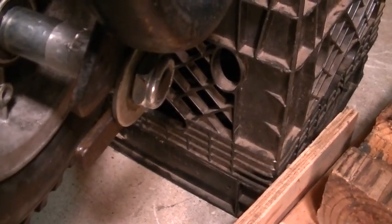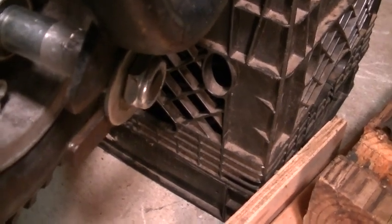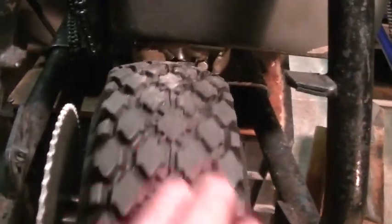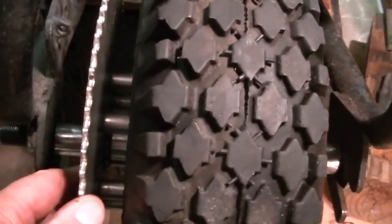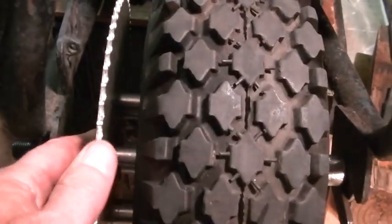I think maybe by taking the axle out and vice-gripping the inside, I can put one nut on equidistant - about halfway - so they come out even. I just snugged it up because I wanted to see what was going on. The wheel looks right, the chain looks right. But there's a wobble - it's not a big wobble, but I don't want it. I thought I did everything right. I kind of don't want to start cranking down on the nuts trying to true it that way.